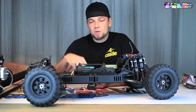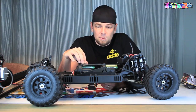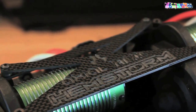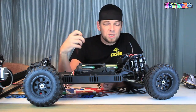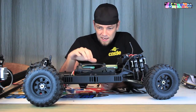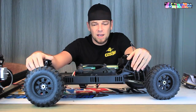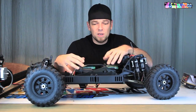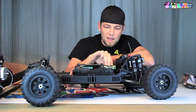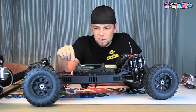Now that instantly poses a problem because I have this carbon brace which I machined — I made a video about that. If you run a regular motor setup, you can still use that brace. But with me wanting to put those blower shrouds on there, there's simply no place to install this initial design. So we need to go back to the drawing board and redesign that top brace. I may make it a tiny bit beefier — there's no flex going on in the chassis as it is, but better safe than sorry. I also want to extend it over the rear motor so I can encase that rear blower too, with the blowers poking out through it.